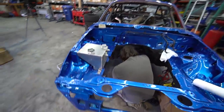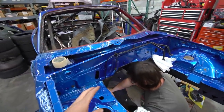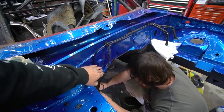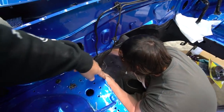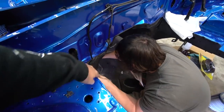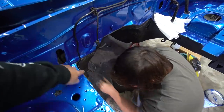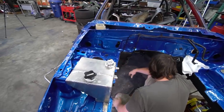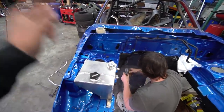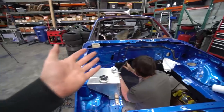One of the hardest parts of building cars is trying to plan everything out. We were going to do the brake lines after the engine was in, but then we realized we needed to reroute them. Normally there would be a big shelf here, but we had to cut it out to fit the V8. The factory lines ran there — with the V8 we have to run them over here tucked to this side. Working on rebending those so they'll be clear of the engine and exhaust.